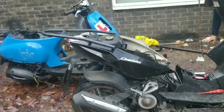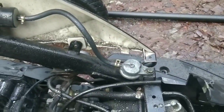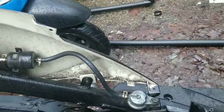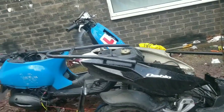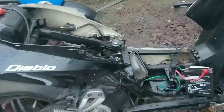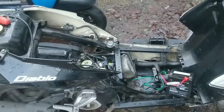I don't know if that battery is the right battery or not - I may just order one. It's working so it doesn't matter. This side shroud is somewhere in there. The bike needs bolting up, the exhaust needs a bolt going through it. I couldn't get to the back here so I think I need to take off the mud guard and just put a bolt back there for the exhaust. Solution to the spark plug wire issue - now it's in there, I just made a hole here, put the wire through, rethreaded it, and tucked it in. The braking is good. I think it rides and sounds great.